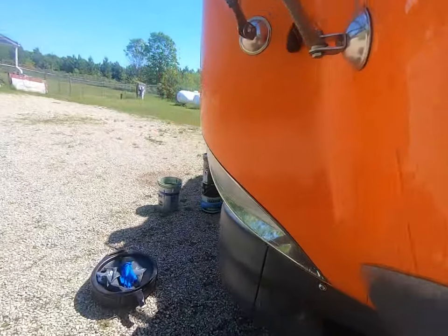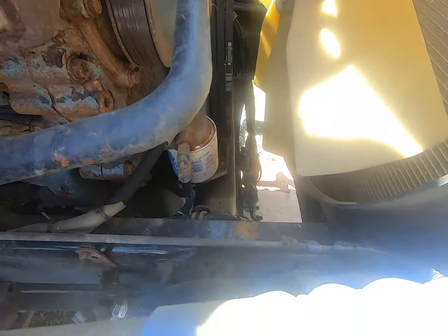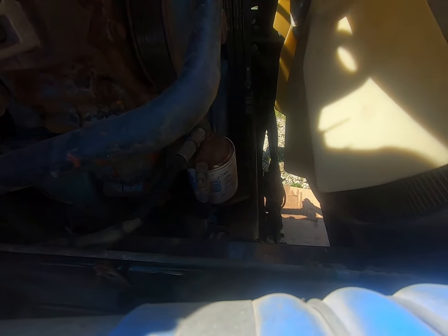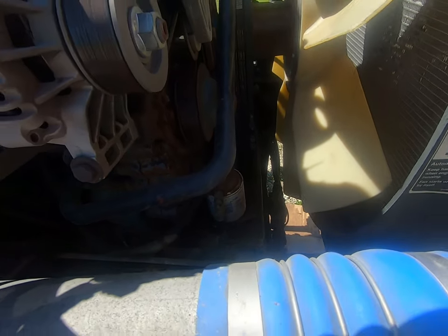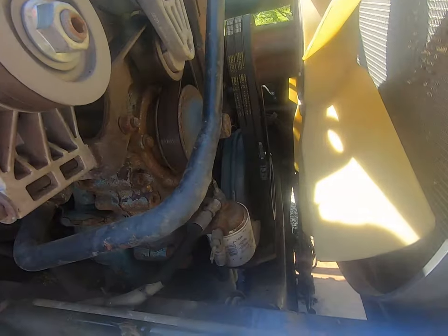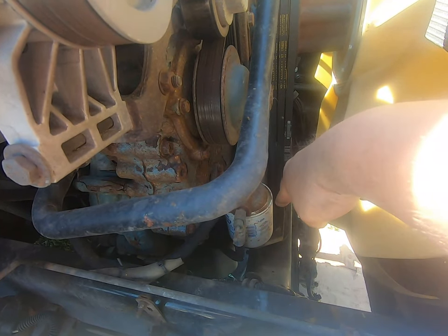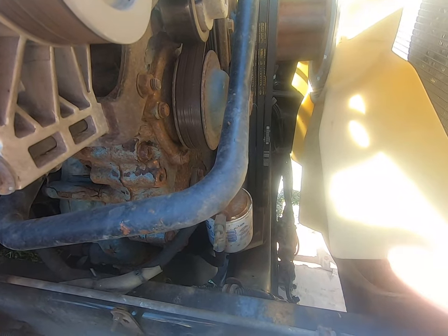As for the coolant filter — if you don't run an extended life coolant filter, you will want to change your coolant filter every PM service. I run an extended one with SCAs in it — they call it a charged one. I don't really need that because I've got extended life coolant, but I got a case of them and want to use them up, so I change mine once a year, or between 100 and 125 thousand miles — they say 150,000. I'll do a video on that when it comes time. For now you just shut both water valves off, screw the old one off, screw the new one on, lubricate your O-ring before you do that, and you'll need to add a little bit of makeup to your reservoir tank — maybe a quart or so.